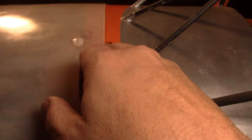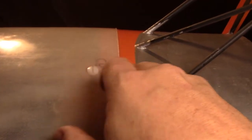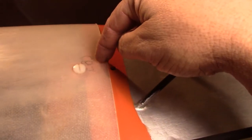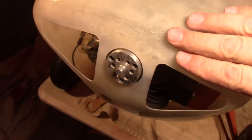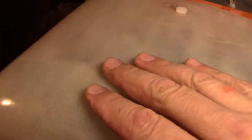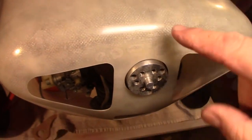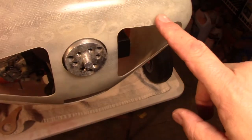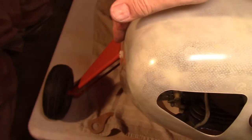That part's done. I still have to figure out how I want to work with this, because I'm still going to fill up the fuel tank from this spot in the center. I may have to cut just a little bit of an arc in the top right here. Plus, I've got to sand it down anyway — just to scuff it up. There are a couple spots I'm probably going to fill, then it'll be a sand down. I'll go ahead and hit it with some primer, sand it again, because this is the only area that you can really feel. It's got little tiny pinholes, but that's expected because it's glass.